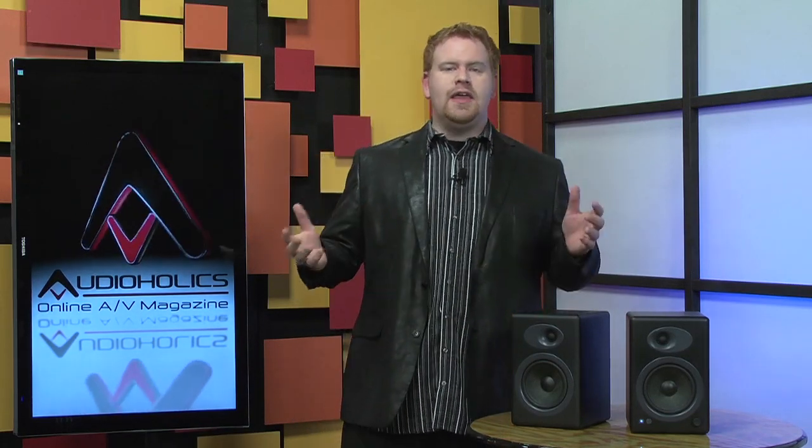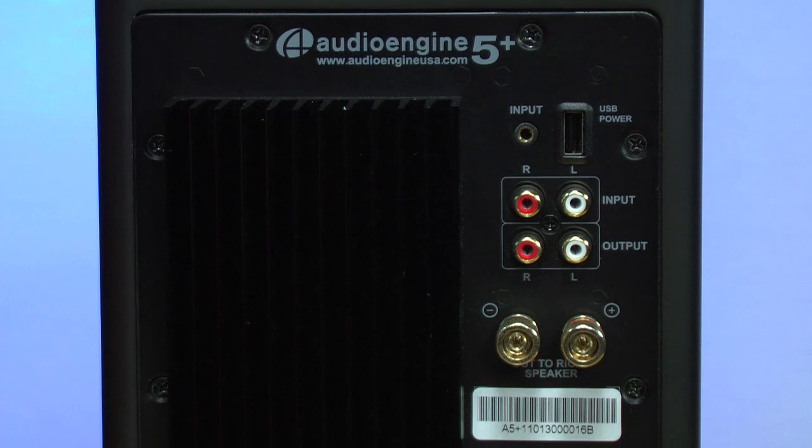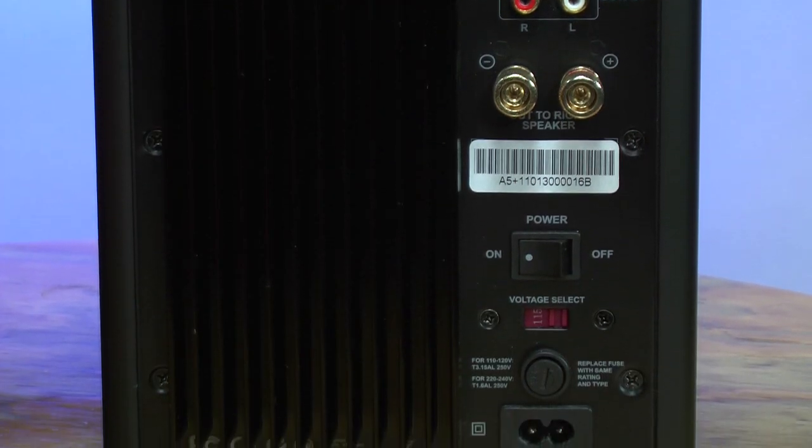The build quality on these speakers is still pretty exceptional, with around a half-inch of MDF for the enclosure, but the front baffles look to have a bit more material. The woofer is a 5-inch Kevlar model and the tweeter is silk-domed. The passive crossover is more advanced than you typically see on speakers costing this much, and the sound reflects an attention to detail with respect to how everything works together. The 50-watt per channel amplifier is all housed in a plate amp on the left speaker, and the quality is superb, with a large toroidal transformer topping off the power supply. The cabinet is hand-finished according to Audio Engine, and the speakers are available in black, white, or a premium bamboo that carries a $70 upcharge. There's also a remote control to handle volume adjustment and muting.